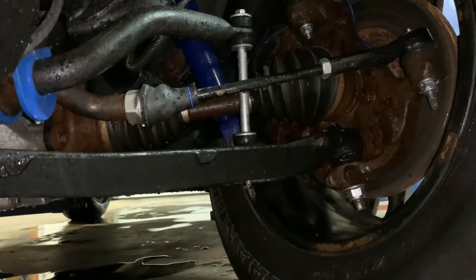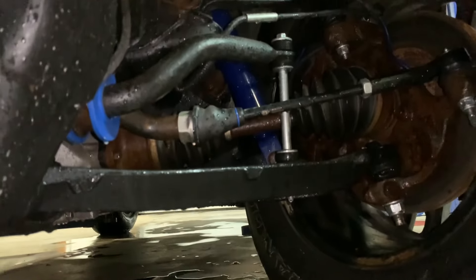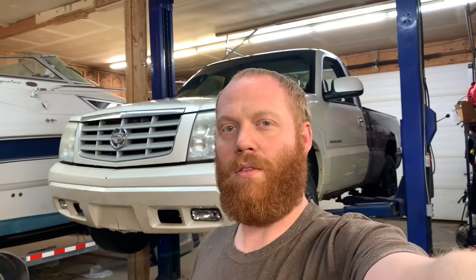It's crazy that my CV axle is actually at an upward angle — I've never seen that before; I've never had a lowered truck before either. We began the wheel alignment but couldn't finish it because there's no sense doing caster and toe if the camber can't be lined up. Negative two degrees, almost to the digit, was the max we could get. After I get this done, I'll get the alignment done again. I really don't want two degrees of camber because it'll wear tires, but I can't afford the thousand-dollar control arms with more adjustability. If I can get even close to one degree, I'll be happy.